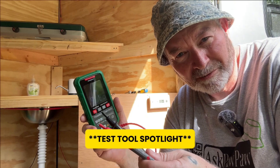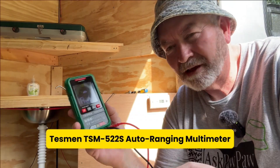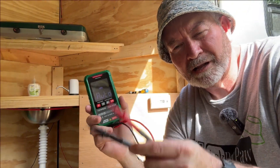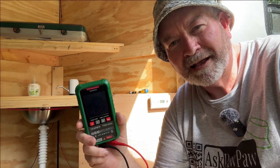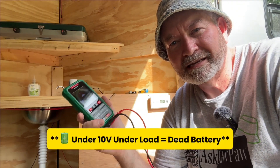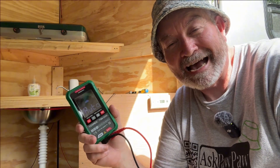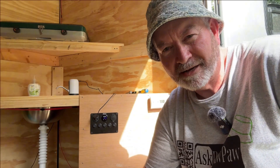This here is the Tessman multimeter. It's simple, reliable, and it saved me more times than I can count. I use it for everything from testing wires to diagnosing bad connections. I clipped this battery in and checked it, and yep, the one I got in here is toast. I charged it overnight before we left, and it still couldn't hold above 10 volts under load. And that's how you know it's not just drained — it's dying. Let me show you the upgrade that's going in next and why I chose it.